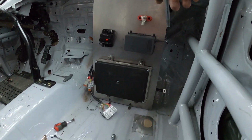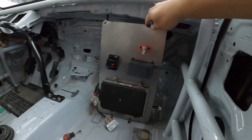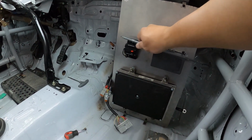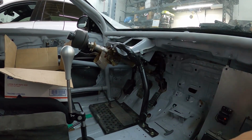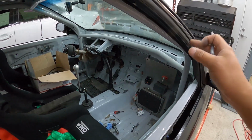And then for the alternator, I'm going to run an 8-gauge cable from the alternator back around this way to this circuit breaker so that I can protect that circuit there, and then it's going to go up to the master switch. So, pre-switch post, that way when I switch that master switch off, it should shut the car off and the alternator won't continue to run the engine.